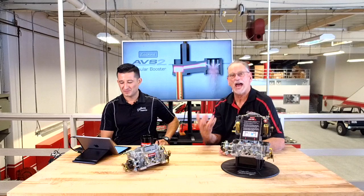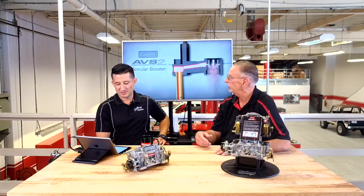With the annular booster, as soon as the fuel comes out of the booster it's like a sprinkler head — it's atomized immediately. It fans out through eight equal orifice holes, as you can see right there, and the throttle response is amazing. And that annular booster is just in the primaries — correct, just in the primary.